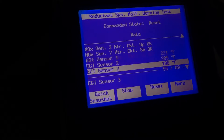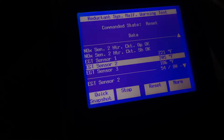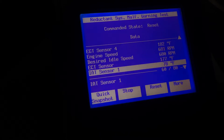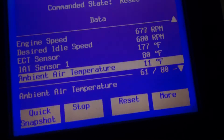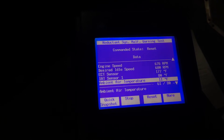Looking for the ambient air temperature data here: EGT is below 300, so that's good. Idling ECT is at 177, which should be above 158 — so that's good. The ambient air temperature though, as you can see, is still showing at 11 degrees. I don't know why, since the sensor is working properly, but the test is running well so far.